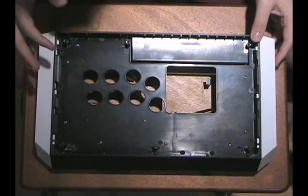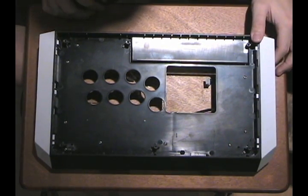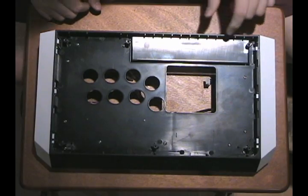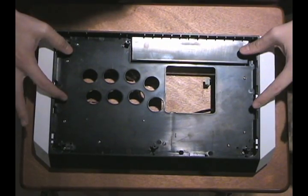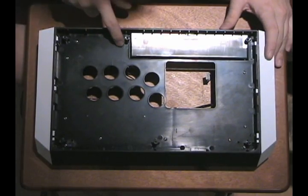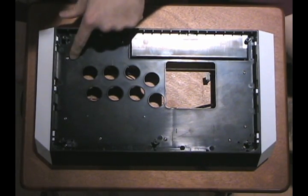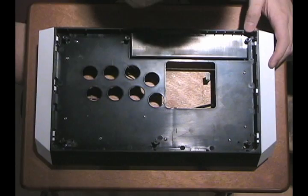As you can see, there's not much you can access here. You can access the joystick compartment and pull out a couple of quick disconnects, but there's no other component you can easily reach if you went through the bottom. As you see here, there are several screws that hold the inside frame — which is pretty much this plate here. I'm going to go ahead and remove these screws, and before I do, I might use a pen to provide some tick marks so I know exactly where these go later on. If you have a camera, that will help too — just take a photo so you know exactly what it looks like.